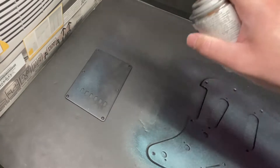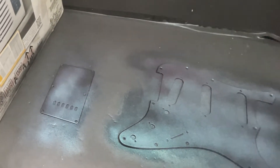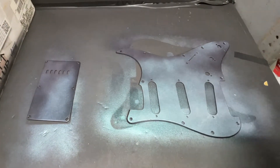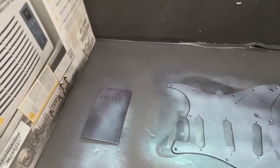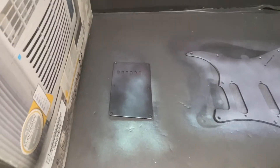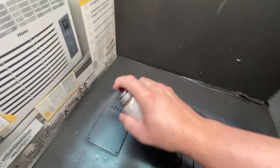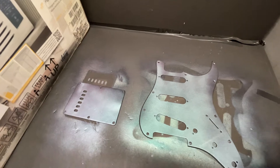That's about it as far as how to do it goes. I'm gonna let my trusty computer companion offer some fun facts about color shift paint. The color shift effect is achieved by interfering with the reflection and refraction of light from the painted object surface. The paint contains tiny synthetic flakes about one micrometer thick, constructed of aluminum coated with glass-like magnesium fluoride embedded in semi-translucent chromium. The aluminum and chrome give the paint a vibrant metallic sparkle, while the glass-like coating acts like a refracting prism, changing the apparent color on the surface as the observer moves. Color shift paints contain no conventional absorbing pigments — the pigment is a light interference pigment. This is why it is necessary to apply the color shift paint over a black base coat for maximum effect.